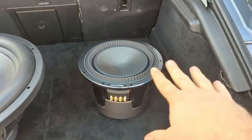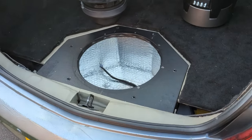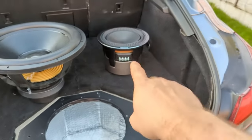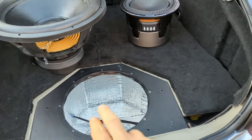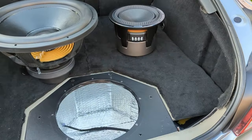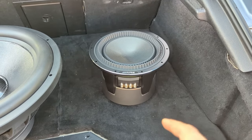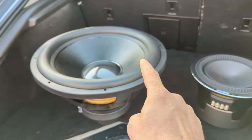So what is the plan for this one? First of all I want to hear how it sounds. Instead of making a box now, I'm going to put it here — I just need to make an adapter ring, a 15 inch ring with an 11 inch cutout, and just plop it in there. I'm going to go IB because the QTS is about 0.5. I'll be running it on the same channels as the front subwoofer, which gives me about 300-350 watts — perfect for testing. Frank said, because he has the same in his car, that this sub sounds amazing, and it should be for the price.